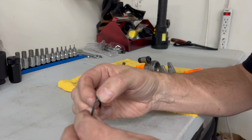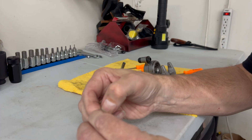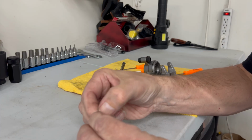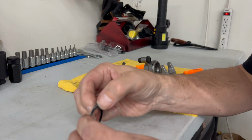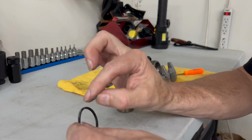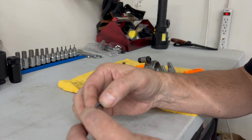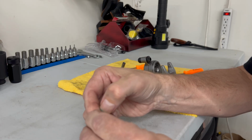And this Cheeto stuff is just stuck right to it, which is making the seal sort of blown up inside. And that way the piston can't return, because this stuff is behind it. So the seal is bigger. It's sticking out because this stuff is all built up behind it. And then the piston is getting stuck on the seal, won't return. Again, this is a budget fix.